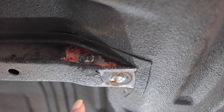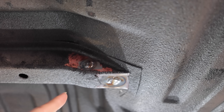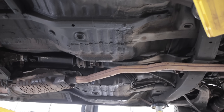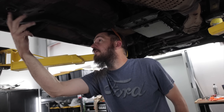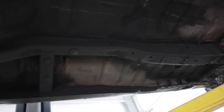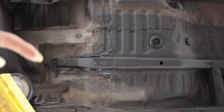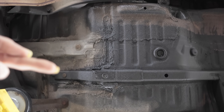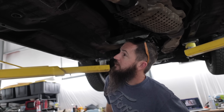Those holes on the bottom helped out a ton because they gave more weld points onto that beam - it's a beam in a beam, actually good to have. With the Celica Supra up on the lift - this car is eight years newer than the Celica - look how similar even the floor is. You can see the front subframe going up to the front of the car along the side of the chassis, and it does almost exactly what Charlie is doing right now, except instead of having them separated, this is being tied together on the RA21.